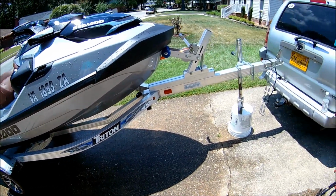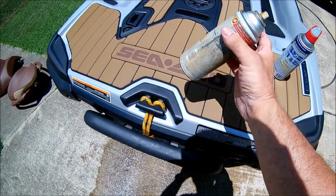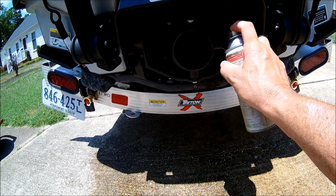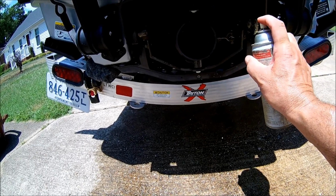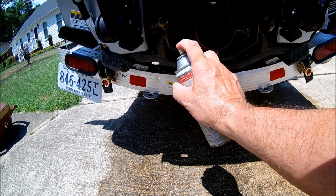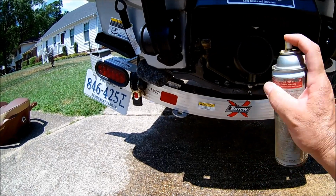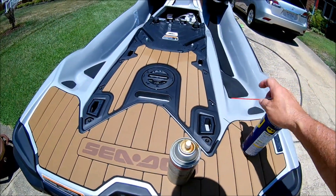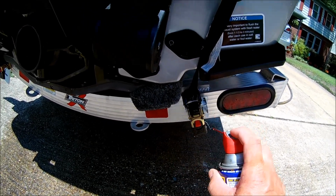All right, let me get this down off the 5-gallon bucket, and I'm going to spray the pump down. All right, so now I use my Fluid Film, and again, this is lanolin based, environmentally friendly, and been used for years. I pretty much spray every joint, every piece of metal, everything back here that I can inside the pump. The IBR, the little hinges here on the gate, everything up in here. What it does is it spreads and forms a coat over it, just to protect it from rust. Now this might not apply to you, but I've got some little built-in ratchets here, and I like to hit them with a little WD-40 on both sides.